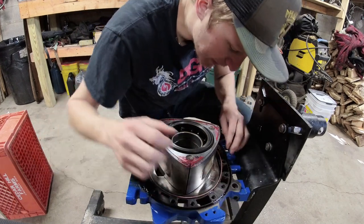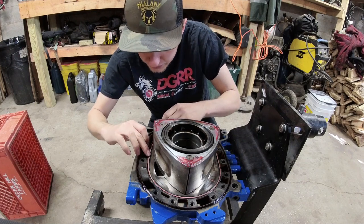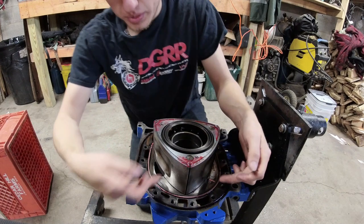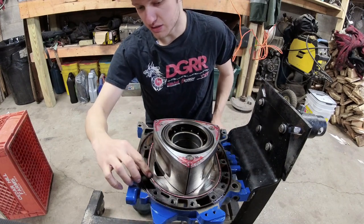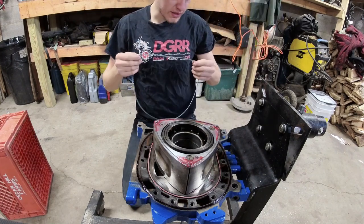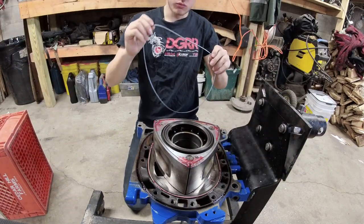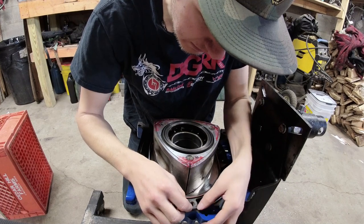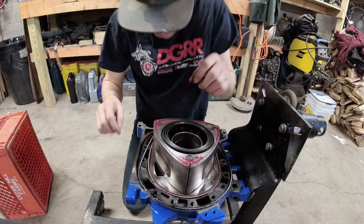Lay the seal down and put the green spot right above the intake port. OEM Mazda seals should fit really nicely, though if it's cold you might struggle a little. Different brands sometimes pop out on the opposite side when you push them in, so it might take more hands. You can use sockets to hold the seal down — it doesn't take much. These have a white trim and a black side — always try to put the black side up and down.